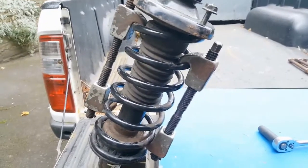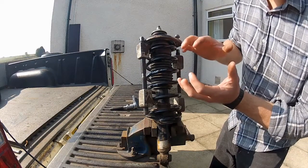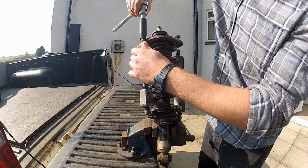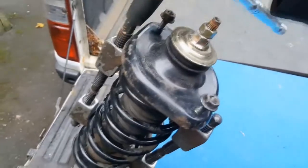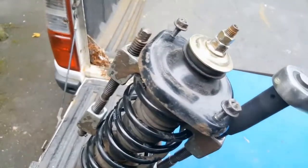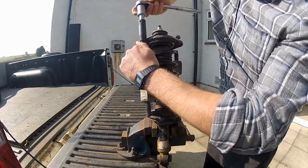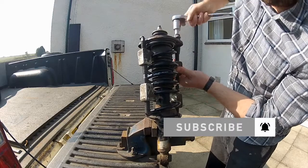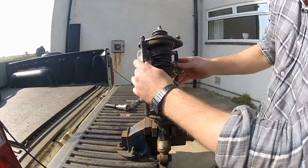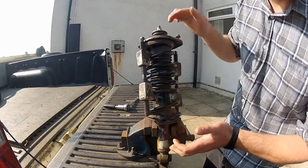That's both spring clamps installed now, so we can begin tightening these alternatively. Work from side to side, tightening them up as you go. What that's going to do is squeeze the coils of the spring together and relieve the pressure that the spring is applying to the strut. Keep tightening, making sure you're tightening them evenly on both sides. Can you see how this spring is now loose inside the strut? It's just flopping about - that means it is applying no force to either the bottom cup or the top, so this top mount can be removed safely.